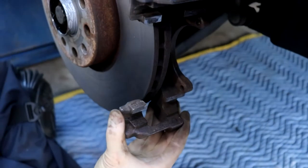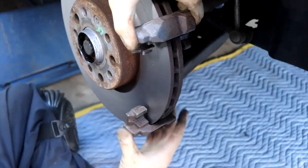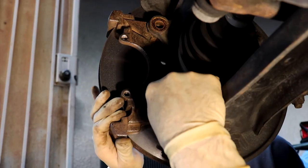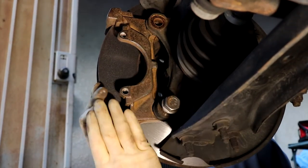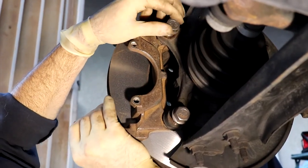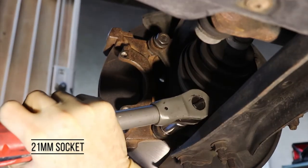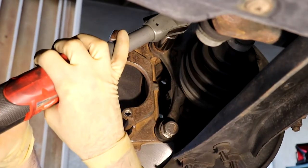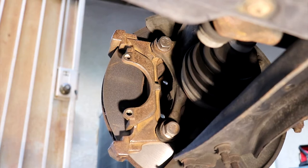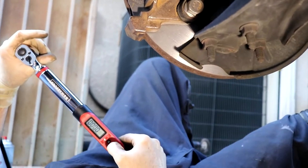Get your carrier into position, then go from the back side and get the carrier bolts lined up. Our 21 millimeter — tighten them up. These are also going to be torqued to that same 89 foot-pounds, same as the rear. Get our torque wrench set.